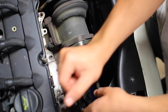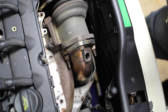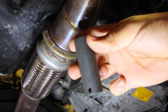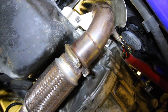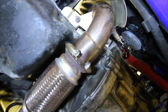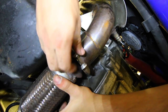The downpipe is held in place by three nuts on three studs on the turbocharger. Use an extension with a 13mm socket to loosen each nut on top. Then go underneath the vehicle to disconnect the v-band clamp at the bottom of the downpipe, using a 16mm deep socket. Push the downpipe down and out of the way — the v-band can be a bit tough, but pushing it forwards or backwards over the hump should work; a few hammer taps help if needed. Once cleared, slide the cat-back out and the downpipe is disconnected.